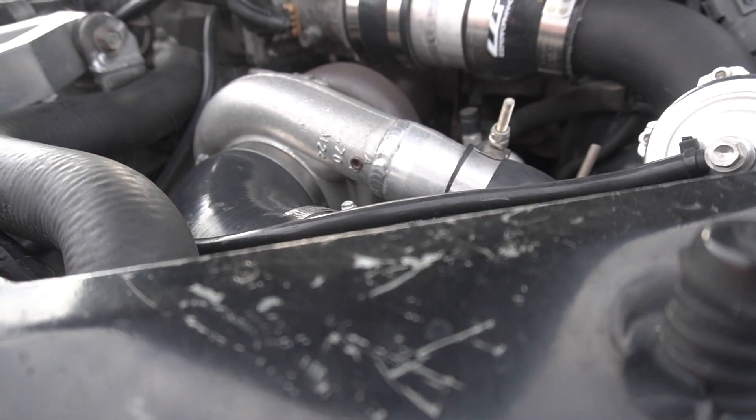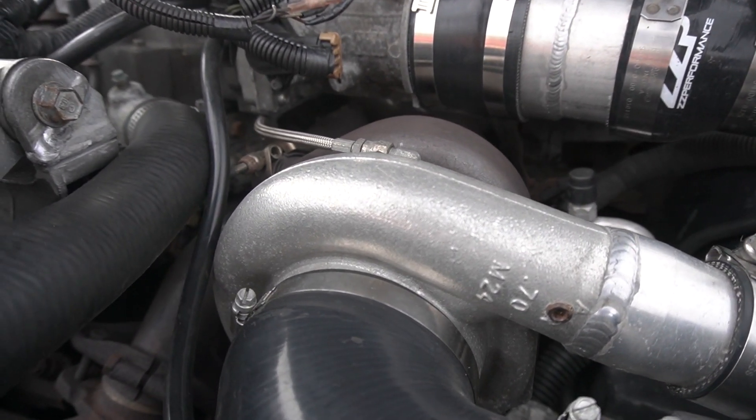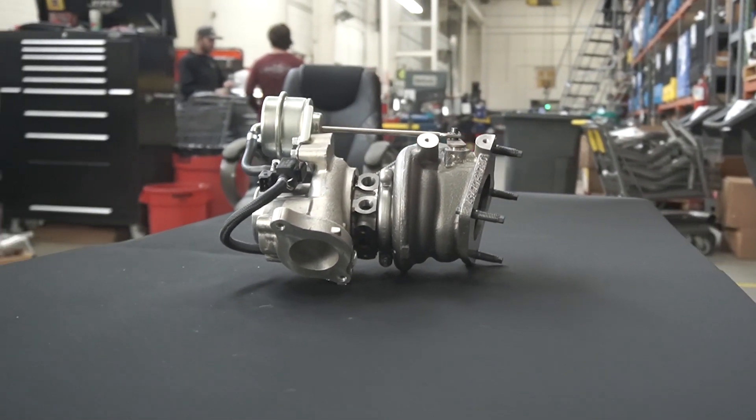Overall, you're going to make your most power with a turbo setup. If you're shooting for the most power you can possibly get, a turbo setup — while costing more — will usually net you more power over blower setups. For making power on more of a budget, a supercharger setup can still make a lot of power. It's just going to take more mods to get up there, whereas a turbo setup you can just bolt on, toss some E85 at it, and make a bunch of power.